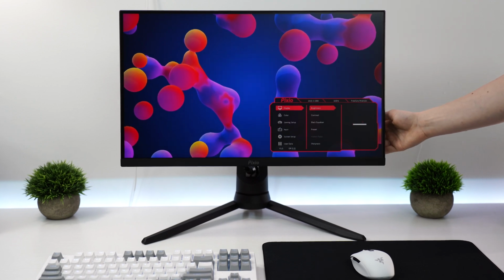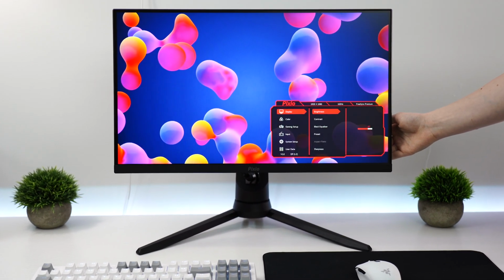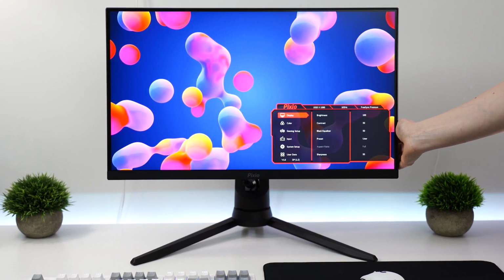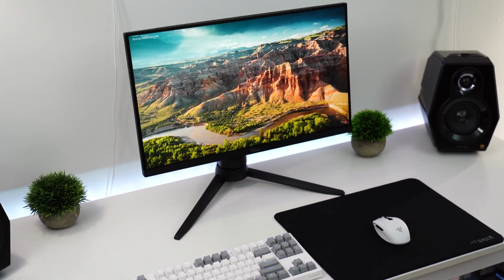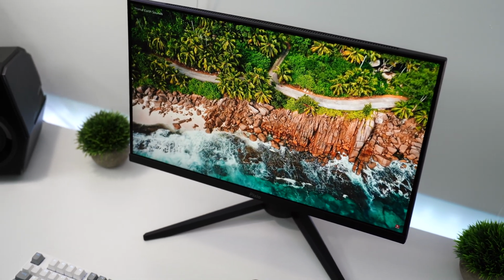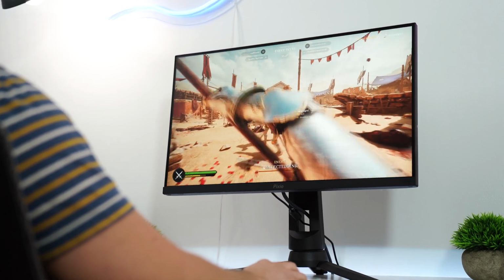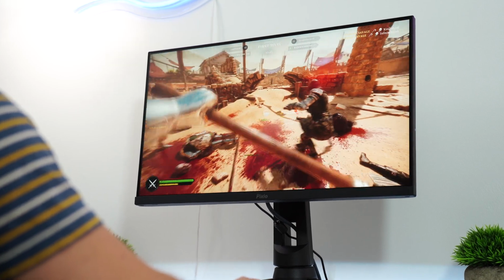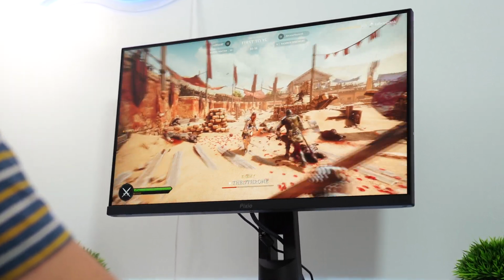All right, brightness here is rated for 300 nits. After testing, this came closer to around 280 nits of brightness, so not quite 300 nits. Now, I personally would prefer something like this to hit about 320 to 330 nits. That would be the ideal range. However, I can cut it some slack as it brings a lot to the table, and again, that price point. In a dim room or at night, there's no problems at all. This thing looks great. It's vibrant. It's not as vibrant as it could be. However, that's going to bring us into the next section.